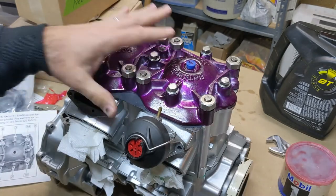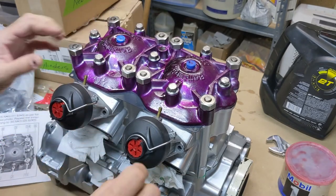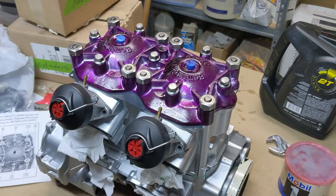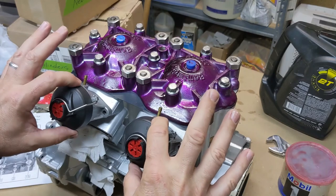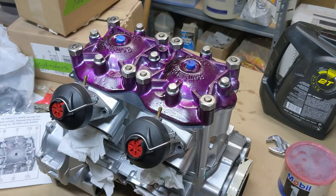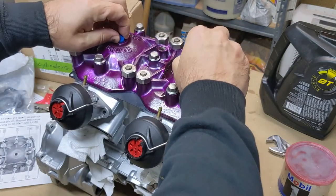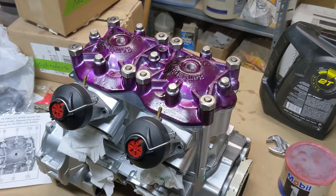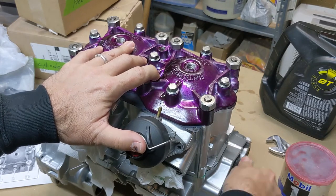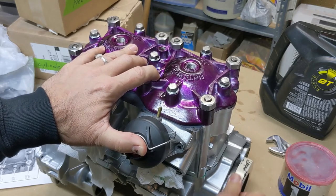should really tighten them all the way down. You want them down in there as far as you can go. On the 95s, this plunge setting goes all the way in. You want to make sure it's seated all the way down. What I actually did is I took the caps off and I pushed the actual stems down as far as they could possibly go in there. And then you rotate. I'm going to pull these out. Can't rotate it with the compression going on there. And then you rotate it and you just want to make sure it doesn't catch and hit those guillotine edges.